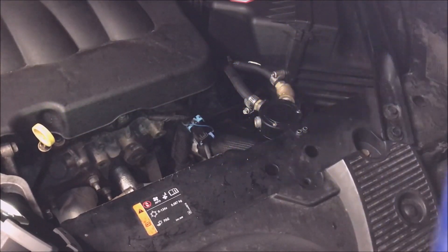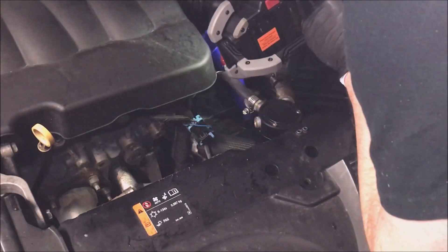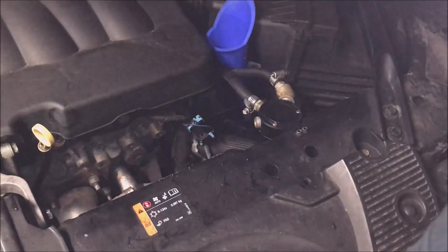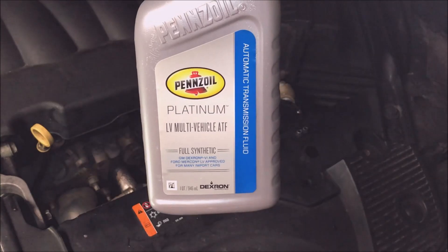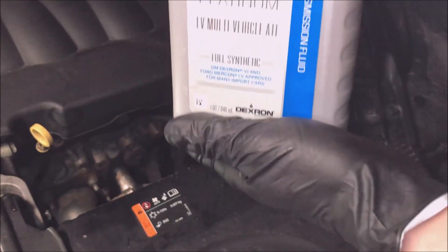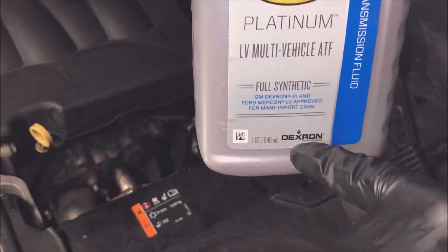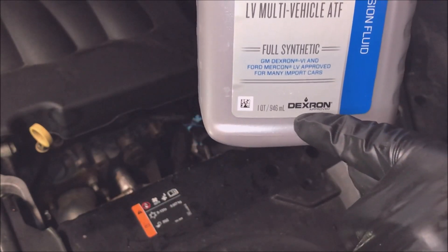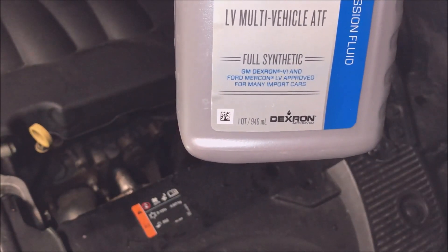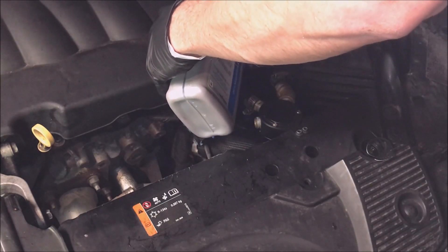Get the transmission fluid funnel — she's been wiped off. Make sure we get it down in there; yep, that's bottomed out. When I originally ordered this from Amazon, the listing showed Dexron 6 only and I thought I got duped. I went on Bob is the Oil Guy and read up — GM does not give out the Dexron license to anything that's not approved for their transmissions, so don't be scared off if you see that. It'll work in Dexron, Mercon, and many other import cars. I've been using it; it's good stuff — decent price, link will be in the description.